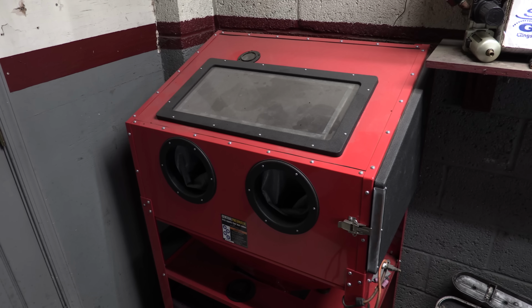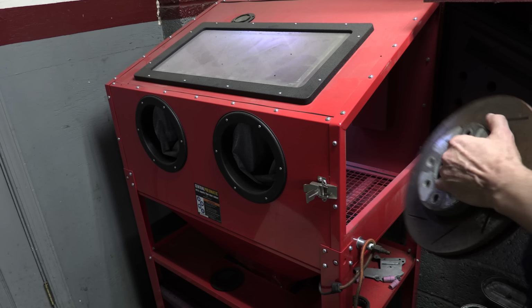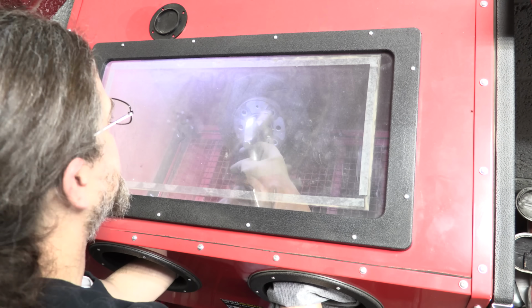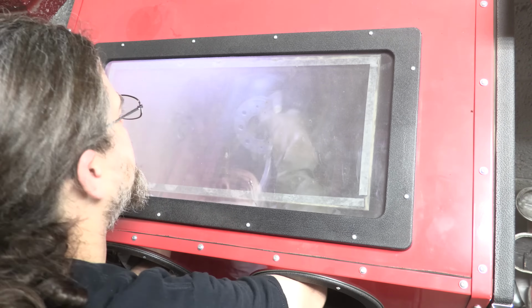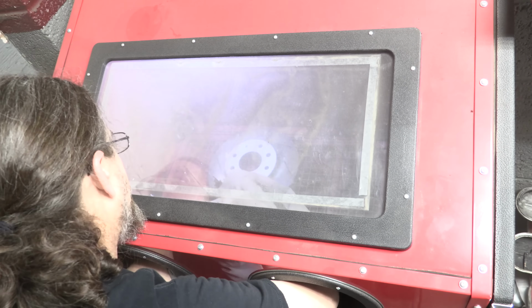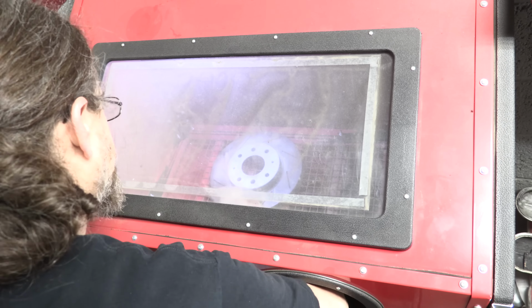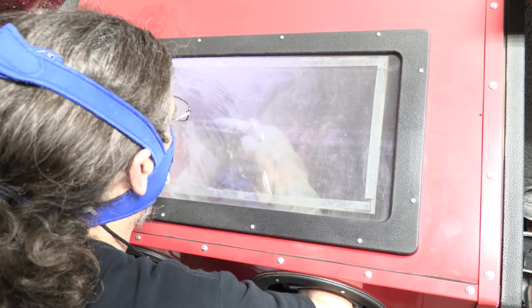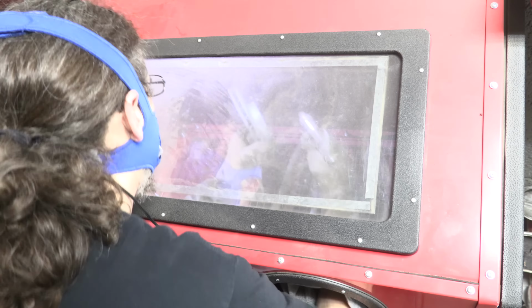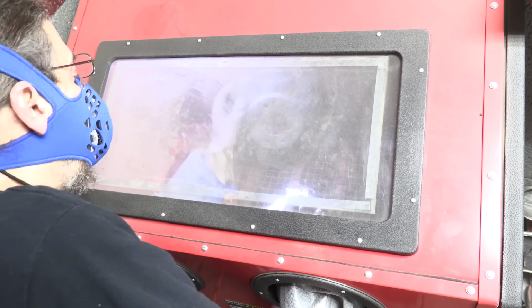It's a blasting cabinet. The blasting cabinet is Matt's, and he told me that I could use it. I thought this would be faster, but nah, it's not. It's just easier. A lot easier. You need a big investment in air compressing to run one of these things continuously. This wound up taking me over 2 hours. The air compressor needed to fully recover, and it also needed to rest for an equal amount of time. So I'd blast the part until it became inefficient, let it fully recover, and then sit and let it cool off.